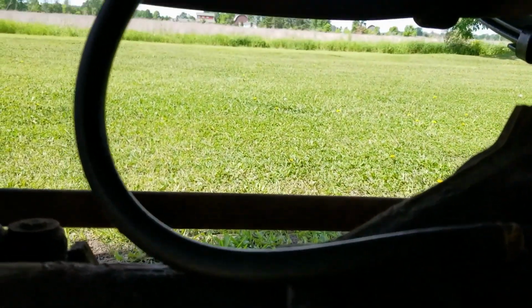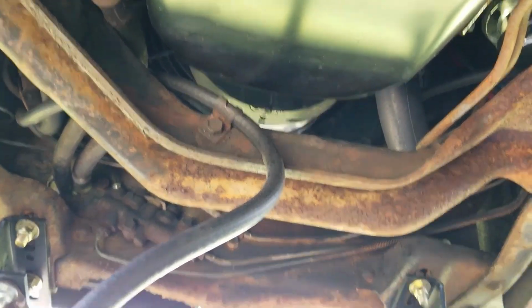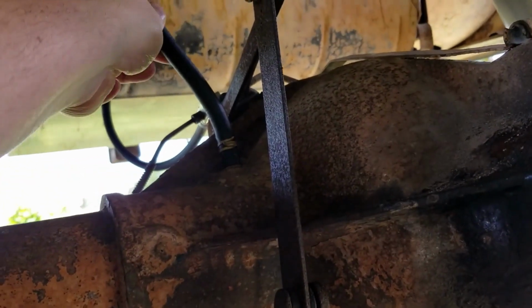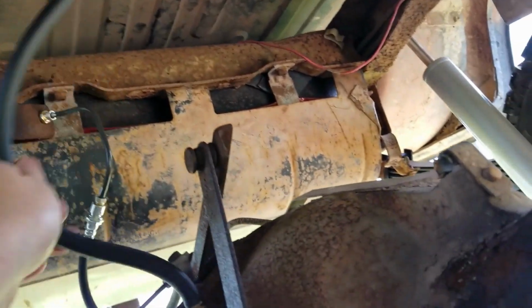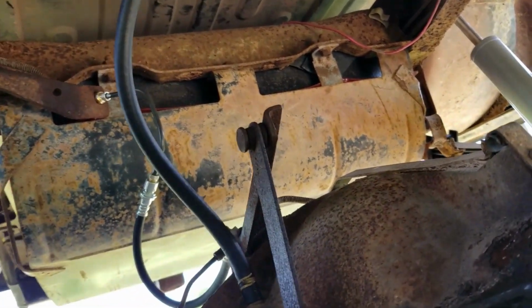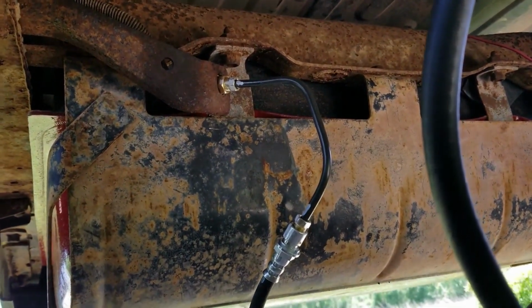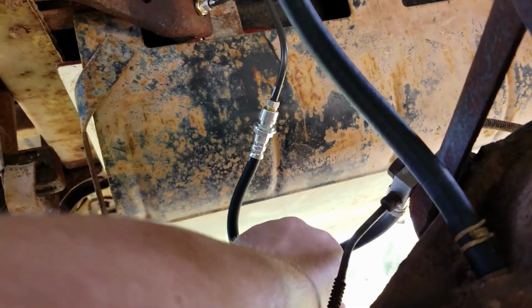Mongo get new vent tube installed. New tube for diff vent. Go up there. Need extra space. Regular tube too tight. Mongo get new vent tube in the back. New diff vent. Goes all the way up. Needed extra space for travel. Did front, did rear. Mongo make custom brake line extension for rear brake hose. Should give lots of travel space.